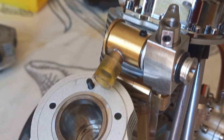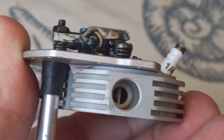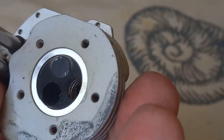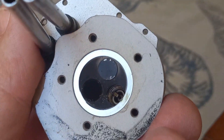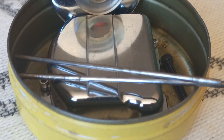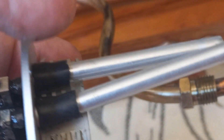You can see how the carb is just pushed in — that's the exhaust, there's the carb intake. I'm going to put a bit of seal on that when I put it back in. For now I'm going to use my tried and true method: after a bit of cleaning, work on the little valve. The head just pulls off once you've taken out all the screws. I've put the push rods over there — I'll need to get them back — but for now we'll use a little bit of petrol to clean up this side.